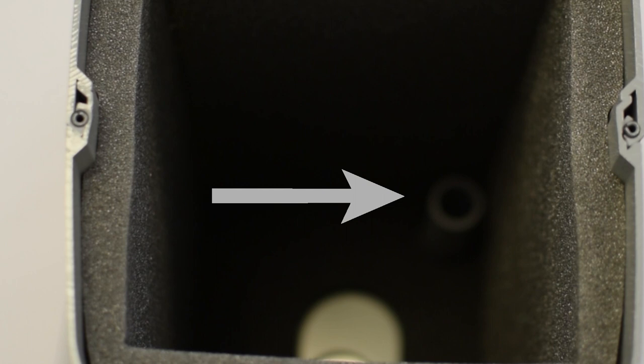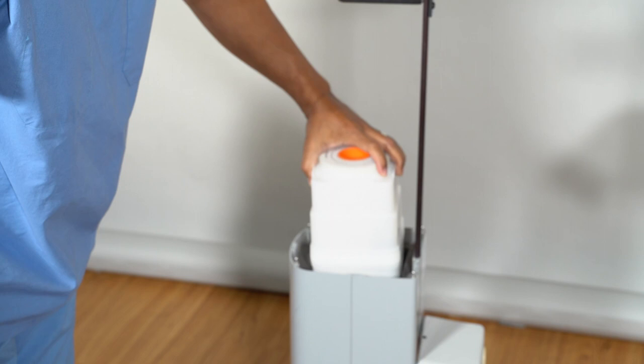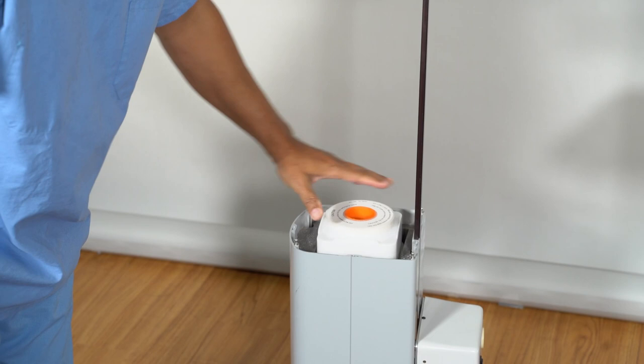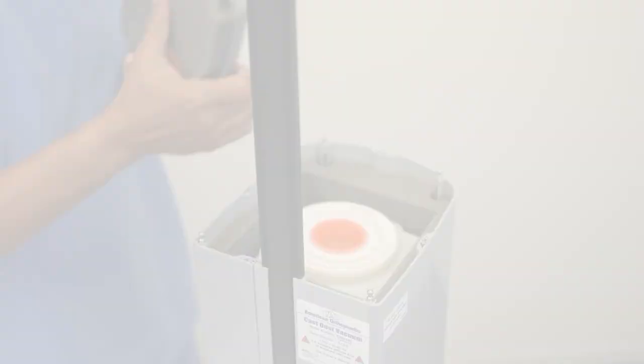When you look into the vacuum after the filter has been removed, you will see a vertical pipe in the bottom corner of the vacuum. This pipe will fit into the opening of the replacement filter cartridge. Holding the filter vertical with the hole facing down, gently insert the filter into the vacuum tower until the filter is sitting snugly. If you cannot slide the filter into the tower, please check to make sure you have the hole lined up with the filter pipe in the vacuum. Once the filter is in the vacuum tower, the lid should be placed back on the vacuum.